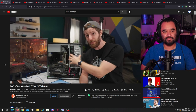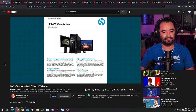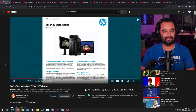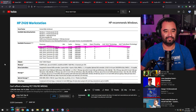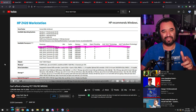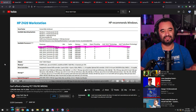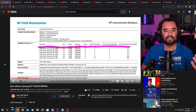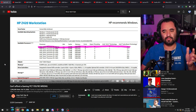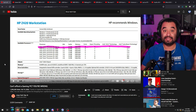The most powerful CPU supported by the motherboard is the E5-2687W. The W designation is a higher TDP CPU - most of these are 130-watt, but W designations are 150 to 155 watts, which is going to necessitate the use of a different cooler or the BIOS will ask for one. The 1620 I have does the same benchmarks on my Z620 test bench - it's a good CPU, high clocks for 4-core 8-thread, around 3.6 GHz base with 4 GHz turbo.